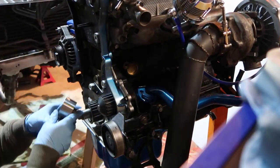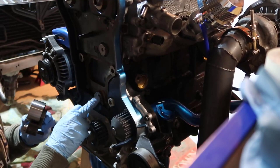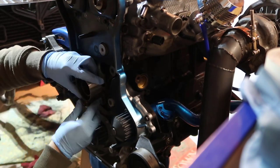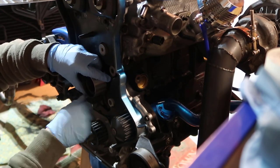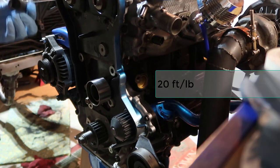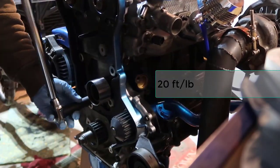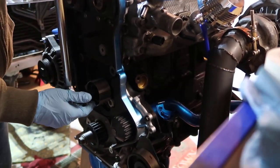So now the pulleys. We have one pulley that goes right in here. Let me see if this looks better. This hole in here, that's where we're going to use this crazy screw here. There's this adapter, my pulley is there already. But basically you just put this guy there, tighten this guy to 20 foot pounds, tighten your pulley to 20 foot pounds. That is probably a 15, yep. So we have here 20 foot pounds. I think it's there already. Yep, and 20 foot pounds.